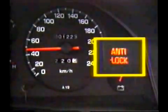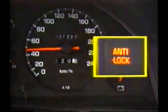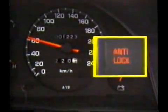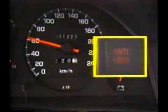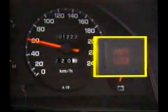2. Next, drive the car straight ahead normally at between 45 and 55 kilometers per hour. At this speed, the warning light should go out and then come on after 1 second. This ends the sensor output voltage fluctuation check. When the car leaves the range of between 45 and 55 kilometers per hour, the warning light will once again begin to blink. This indicates that there was nothing wrong at the time of the output voltage fluctuation check.